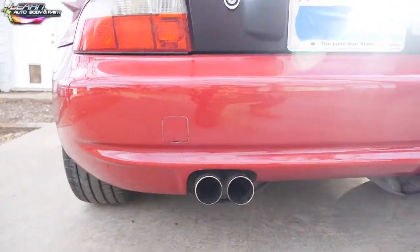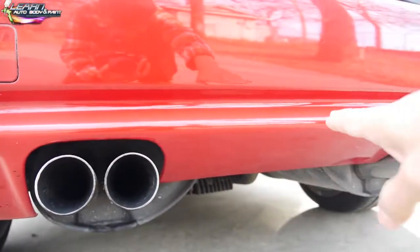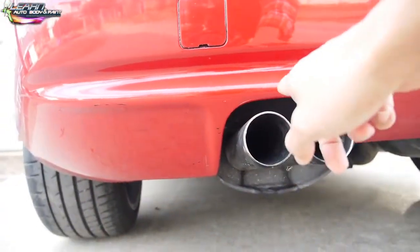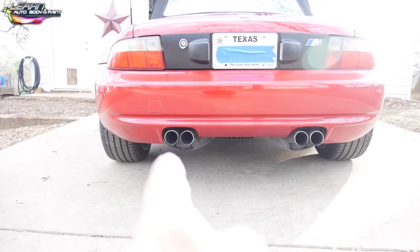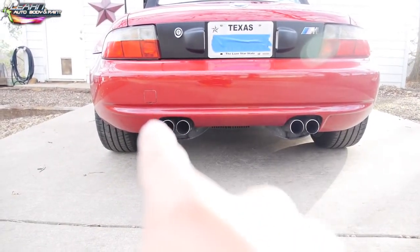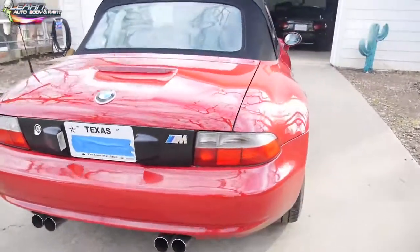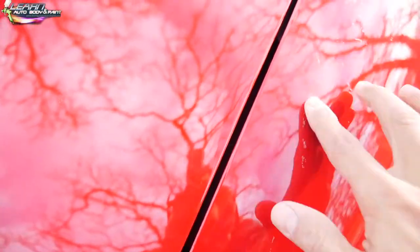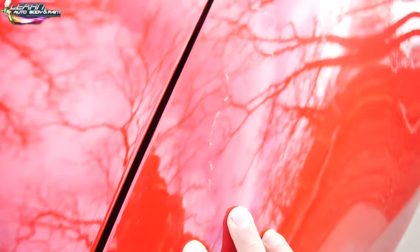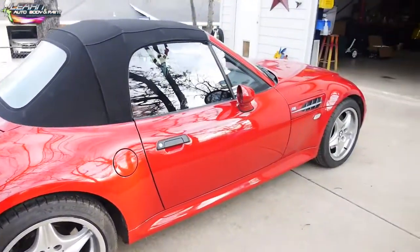When I paint the rear bumper cover, I might even make it two-tone — like some cars with a diffuser where this lower area is black. I might mask out some of this area and do a two-tone black where the black comes in here. Also, we got some glue from the tape here — this will come out with some clay bar or lacquer thinner on a rag, then proceed to buff the car out. It's not a completely done project, but most of the hard work is done.